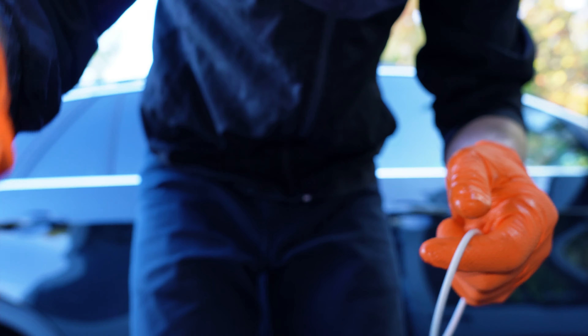Clean everything outside of the hole, then get a funnel. We're using European Car Formula 5W-40 — approximately eight and a half quarts, plus or minus. Check the dipstick — right now it's very low at the bottom. I'll add half a quart, start the engine, and we're on a flat surface. I'll check the level again and fill it up if needed. Otherwise we're ready to go.